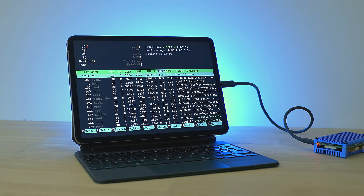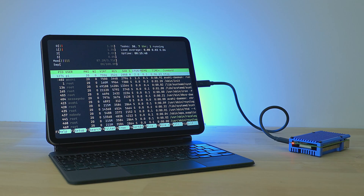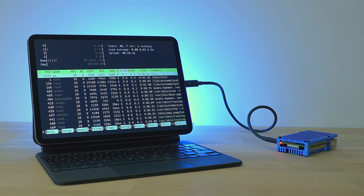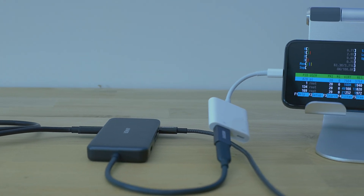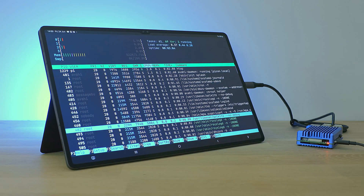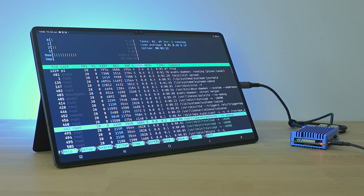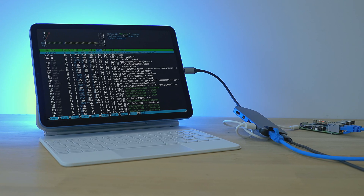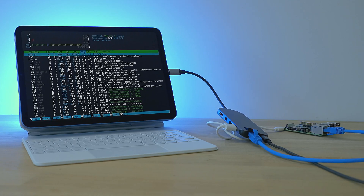We're going to look at a bunch of different configurations in today's video, and I've put timestamps in the description for each of these sections. We'll start with a simple one-cable setup for the Pi 4 that works with USB-C iPads, and we'll expand that solution adding various options for powering those two devices. We'll expand even further to look at lightning-based devices like the iPhone and older iPads, then a USB tethering solution that works on Android, some iOS devices, and older Pis like the Pi 3. Finally, we'll look at a pure Ethernet-based solution that is a great fallback for other single-board computers.